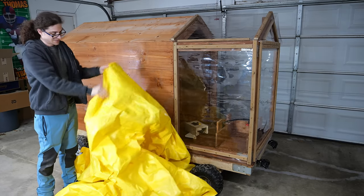I then head over to the opposite side and fix that piece of tarp down to the roof as well with some more tape and some more blocks of wood on top, followed by some screws to really pinch it in place. I did it on the opposite side of the roof as well. For this little front section between both of the vinyl windows, I decided to add a couple pieces of tape followed by a small thin strip of the yellow tarp and a couple staples just to hold it in place — this is just going to make me feel a little bit better about that seam between the windows. After doing the same on the opposite side, it was time to tackle the loose flap on the back. I fold it inside the crease, take the staple gun and put in some staples, then take out my utility knife and trim off all of the extra. And now we have a nice waterproof roof that will always remind me of some of my previous adventures.